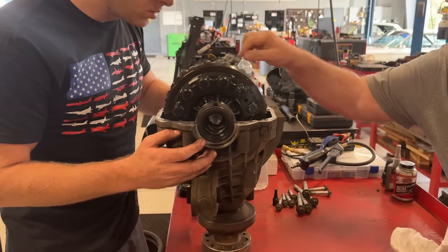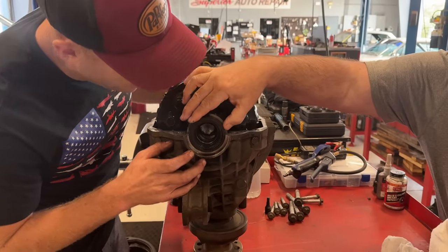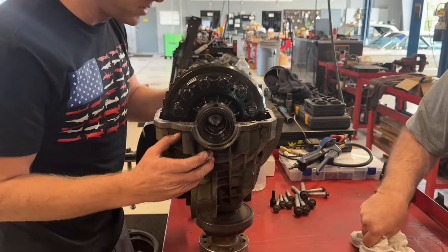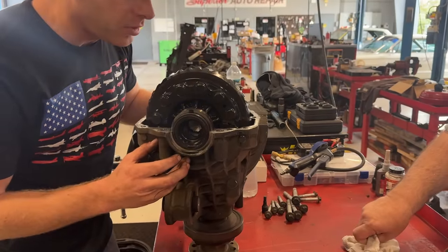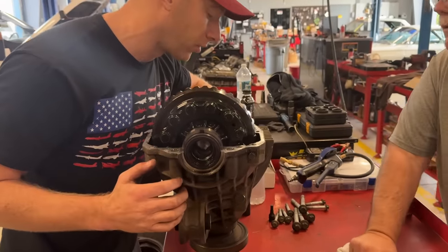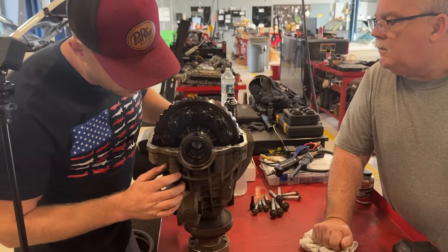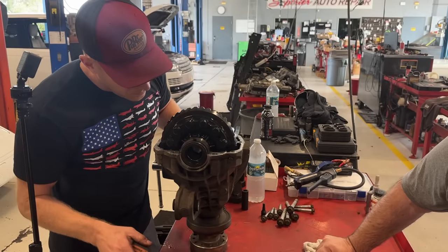End play is about 8 to 10 thousandths — that's fine. One side is locked further because it's for the locking side versus non-locking side. There's no groove on this side of the housing but there is on the other. It is unidirectional here.